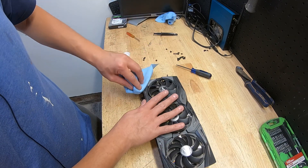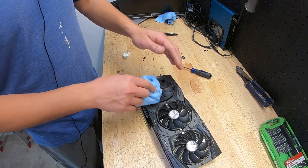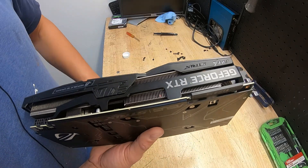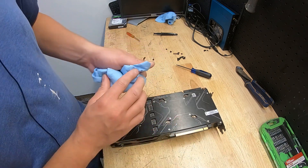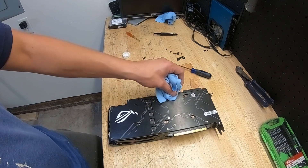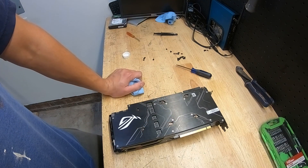Done — simple. She still looks great, brand spanking new, and this card should get back to the temps I had when it was brand new. Just wanted to do this quick video showing the ASUS 2080 Strix — how to take it apart and change the thermal paste in case somebody was curious. This is actually probably the easiest video card I've ever done. Clean it out, clean the surface, put some good thermal paste on — whatever brand you prefer, I like Thermal Grizzly — and you're good to go. Pop her in the computer, do a couple of stress tests to burn in the thermal paste, and you'll get better performance. Comment below and let me know what you think. Thanks for watching!